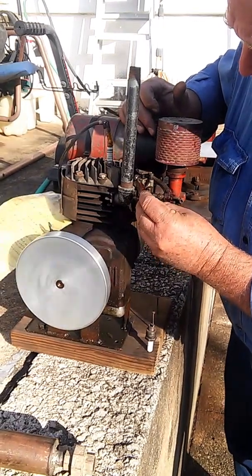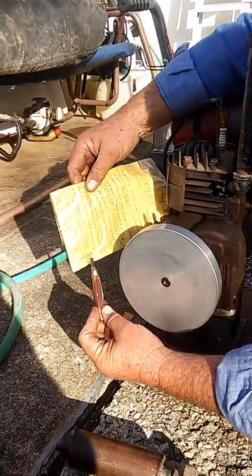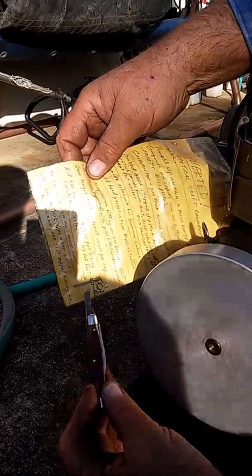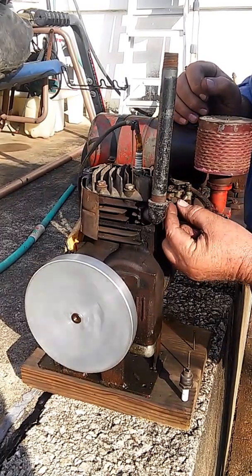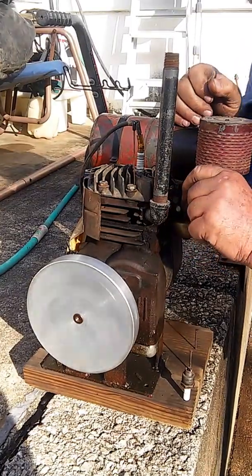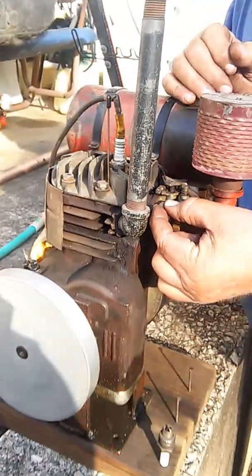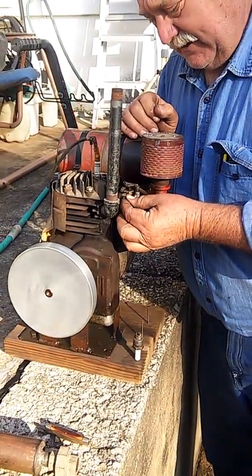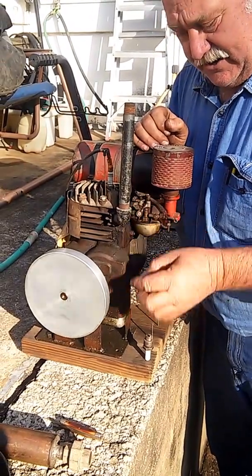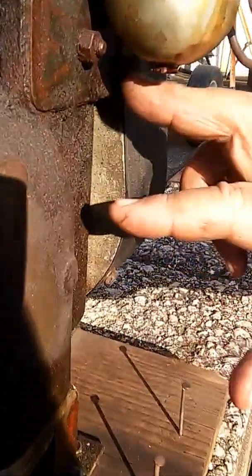I made instructions on all this stuff — there's where I made my rod with the dipper on it. You can get her down there talking if you play with it. I made a flat spot on the mixture screw so you can see where you've got it. That's richening the low speed up a little bit — you hear it hitting every fourth time instead of every second time. If I come back in here a little and find its sweet spot, then you can idle it way down. You can actually hear the tappets, hear the cam touching the underside of the valves — that's what that high-pitch ticking is. I'm going to put the muffler back on.